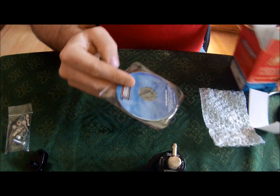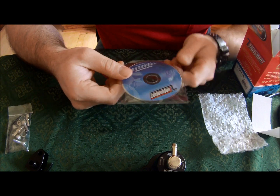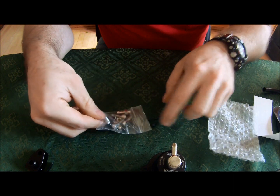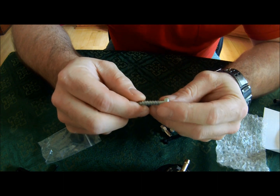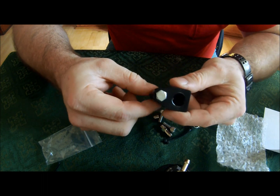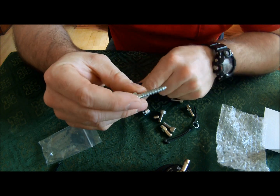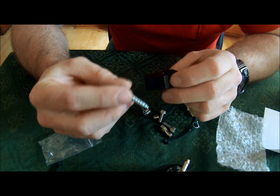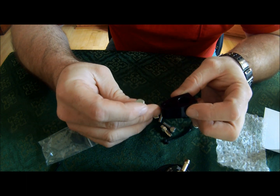And we have the mini CD with the instructions. I have not looked at this yet, so I am going to take a look at it and then show you how it installs. But before I do, I want to talk about this — we got some vacuum line fittings with this. I hope they don't expect me to put this into the MAP sensor where the boost port adapter is. Which it looks like they are. Look how coarse that thread is — this is like a wood screw. I've had one of these when I bought a cheapo off of eBay and that's all they expected me to put on my car. I did not. I actually went out and bought the Craven Speed boost port adapter. So we will take a look at that and then I will give you an assessment.